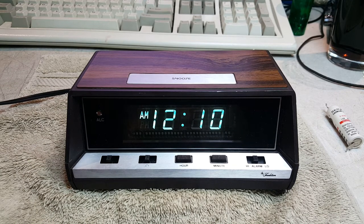It's wood grain — obviously on the right-hand side, it had a sticker that said 'simulated wood grain,' but that came off in the cleaning process. It has been cleaned and Novus-ed and alcohol-ed. The VFD tube inside was cleaned, as was the inside and outside of the screen. The entire exterior was Novus-ed as well, and the power cord was vinyl-exed.